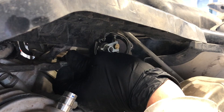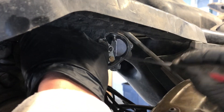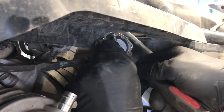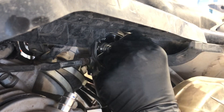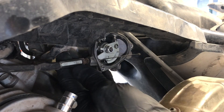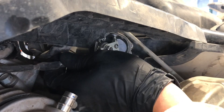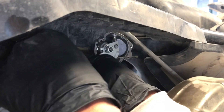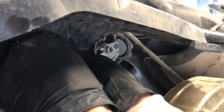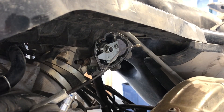You'll take and do the same thing here — totally unscrew that. That throttle cable will actually come out of the end of this, and you just pull it out of that groove there. It's got a little brass fitting on the end. So that's what that looks like. Then once you've got the 8-millimeter loosened, you can go ahead and unscrew this and that entire throttle cable will come out the end of there.